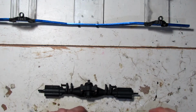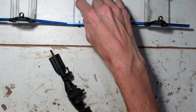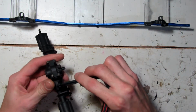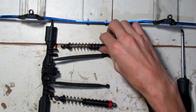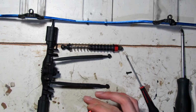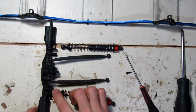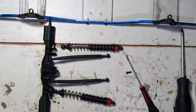Do the work. Alright, first I suppose we'll start out with the rear axle and these upper links, because that's the only spot I have to mount to right now, and I'm still going to have to pull this plate out and do some work to it. So the spot to mount these is right here. Alright, so there's spring 1, spring 2. I'm concerned, these things are pretty long. It's going to sit pretty tall. But once it's sitting with all the weight of it together, that might change. So let's get on putting these in. It is a tight fit into that shackle onto here, so I have to coax it in, but I'll update you guys once those are on.